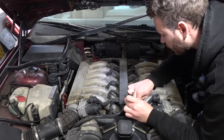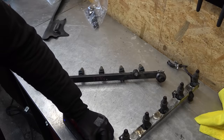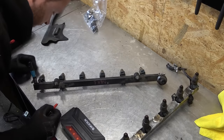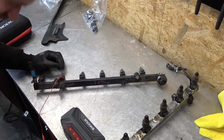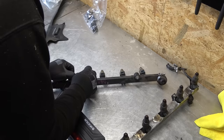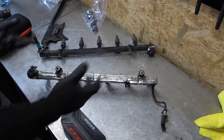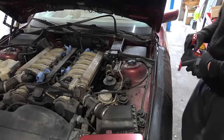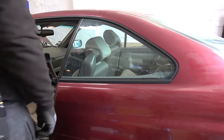I'm going to try and activate a couple of injectors just to see if they click. Pay attention to the positive and negative — there's a plus sign on this one. That one is clicking, and that one as well, so all of them are firing, which means the car would have probably started with these injectors. The question is how well they're firing. Good time as any to find out if the windows work — connect the jump pack and let's see.